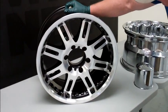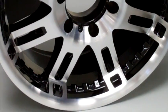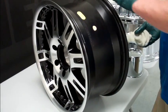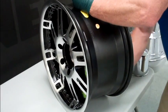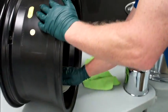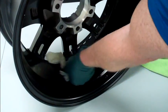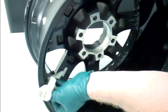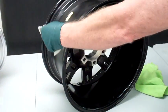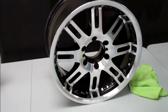Alright, we're at the powder-coated wheel. As we mentioned, it's a fairly open wheel design, which means part of the visual appeal is that black powder coat on the back. When these are brand new out of the box, it's the perfect time to do this — you don't have to jack your car up a month later and pull the wheel off to clean everything, which can be fairly challenging because these wheels accumulate a tremendous amount of dirt and grime on the backside. So right out of the gate, fresh from the box, this is the perfect time to put a coat on. I always start with the back — just trace a line along the edge of the front, and you can see the powder coat really raises the gloss level. More importantly, it seals that powder-coated surface off from dirt and contaminants, making it very easy to clean. Uncoated, in about a week or two you're going to have a layer of gray metallic brake dust back here. This product is very, very slick.